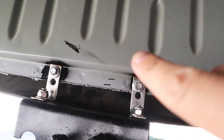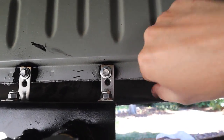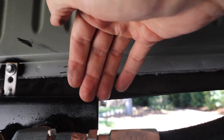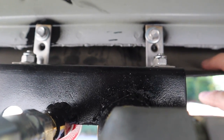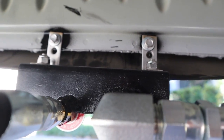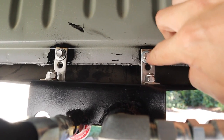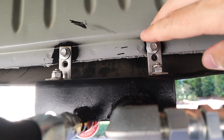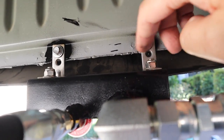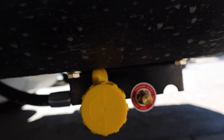Here are what the two L-brackets look like. I just cut the tops of them both off, drilled out some new holes, and drilled holes directly through this lip here to mount the brackets to. I cut off the back of the L-bracket on both of these as well, and now this mounts right up underneath the plastic trim on the van — it's perfect. I thought I'd have to cut that plastic trim a little bit, but that was not the case. I painted my holes once I drilled them out to protect from rust, and otherwise all my components are either stainless steel or galvanized. On the outside of the van it's a pretty low profile, with big 5/16th inch bolts holding it in place with lock washers.